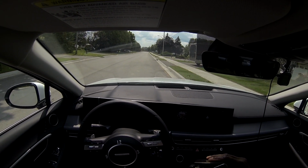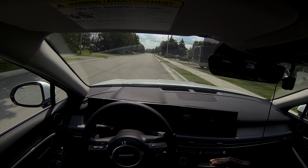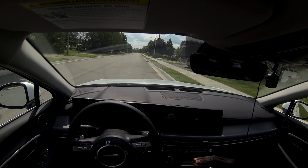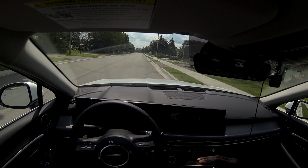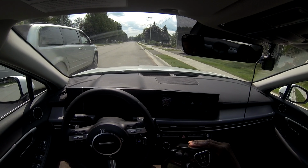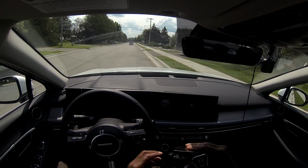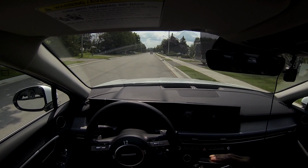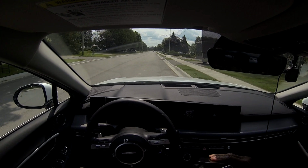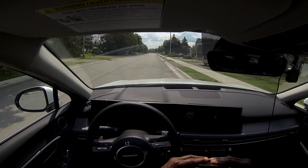I had one of these in there, and when I turned the ignition off and then looked at this thing, actually it's another one, which is called a Schumacher, but it does everything. It tells you when the battery is dying, and it tells you when the alternator is dying. So once I got all that rectified, then I got the car started. It went up from 11, because at 11 the car will not start. Some cars you might be lucky enough to get it at the right time with 11 volts and it will turn over and start. But my car did not start with 11 volts.